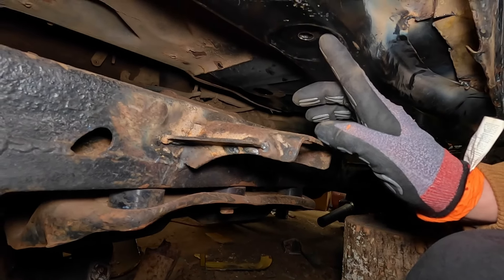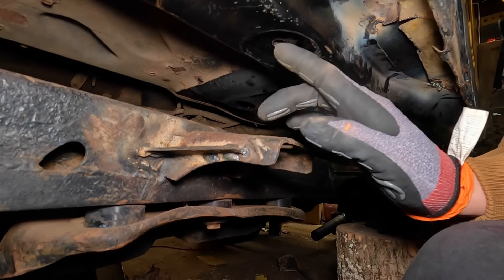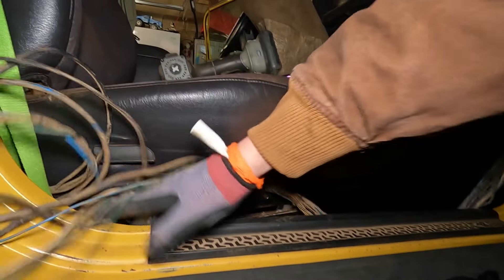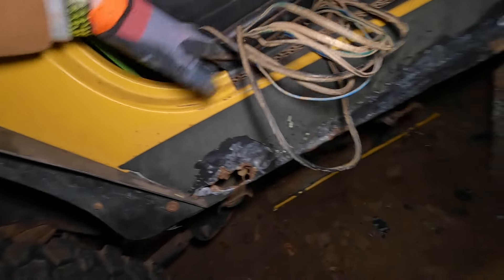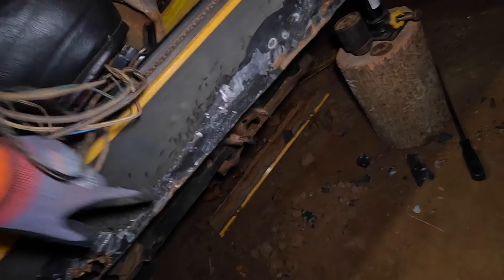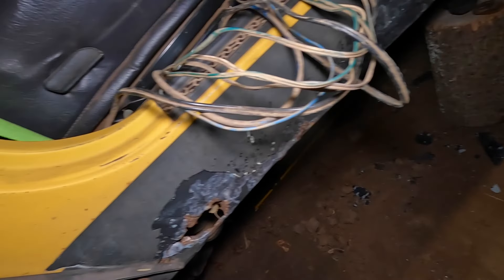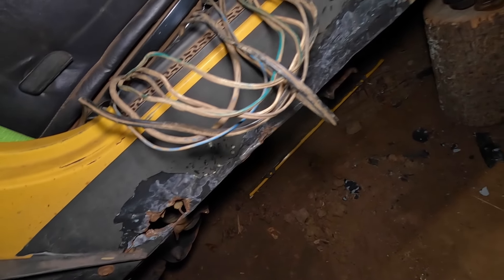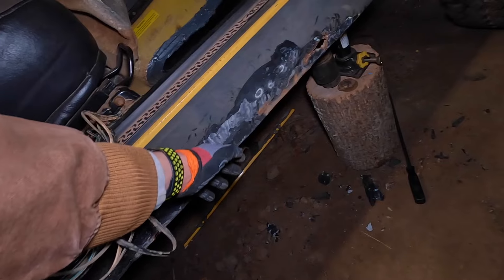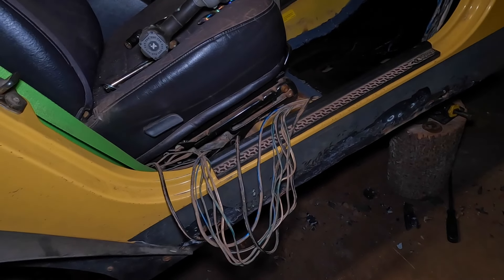This body mount — for whatever reason the powder coat closed up the threads, so we're going to have to come back in here with a tap and open them back up. Not a big deal. That one is mounted, the other one behind it is mounted as well. This area was rusting through and when I jacked it up it started to crumple in. There was a little bit more rust here and here. I'm going to clean all of this up with a grinder at home, throw on a little bit of bondo, and make sure it's all nice and flat.